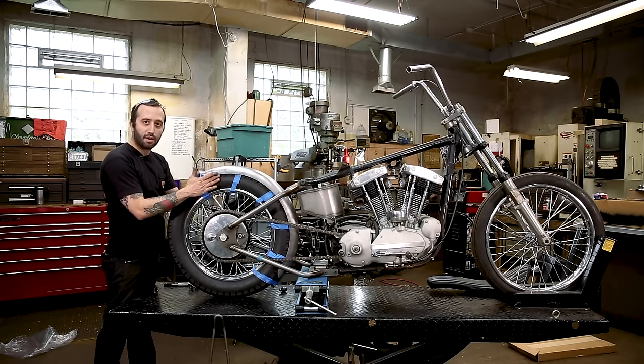And then get your center punch. The nicer you lay this kind of stuff out, the nicer everything lines up and the happier you'll be bolting this thing back together. There's nothing worse than trying to bolt stuff on and the bolts are under tension and scratching on one side of the plate and not the other. So take your time lining this stuff up.